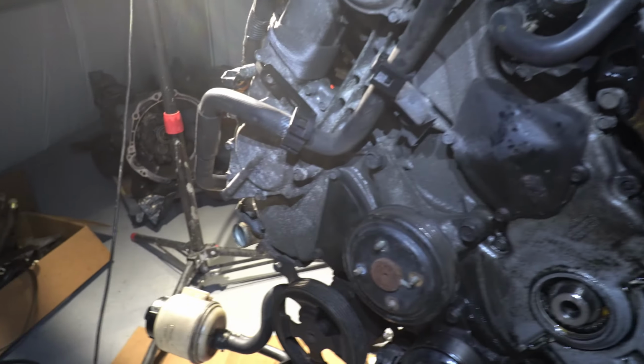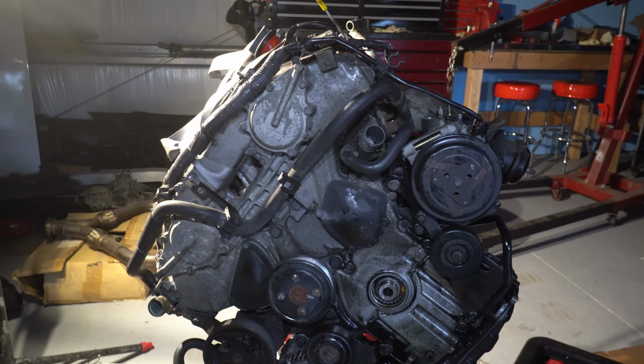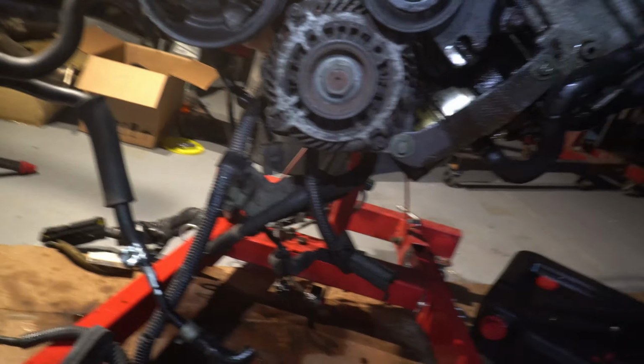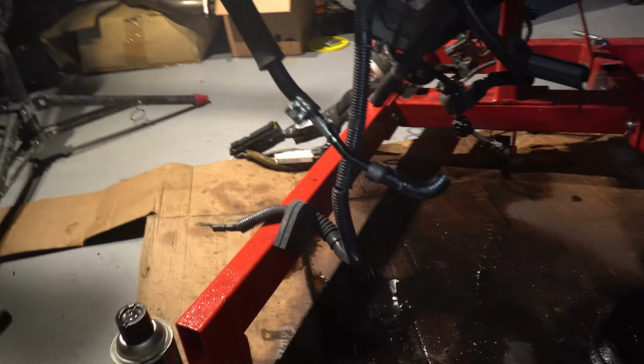All right, so I don't know if we explained in the last clip, but apparently the front main seal is bad too. Yuki kind of ripped it apart, but it's okay. It's definitely dry. It was dry rotted, 100%. That's why it was leaking oil too. Just hoping we're not seeing oil from in between.